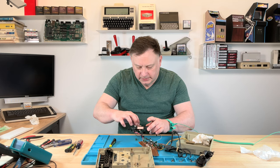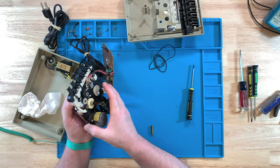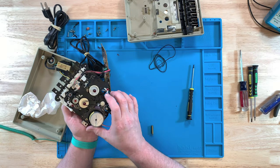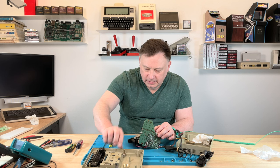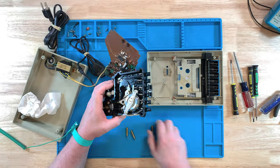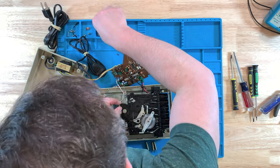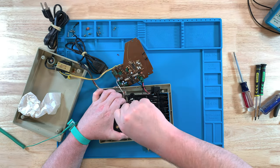The motor turns the flywheel, turns the rubber there, which turns that belt that was hard to get out, which then transfers over to here and turns the counter mechanism. Let's go ahead and start putting parts back together. Get these four old belts out of the way. I've got these three parts I took out last, and I did take out this small screw right here — I don't think that had to come out at all; I'm just going to put that back in so everything's solid while reassembling.